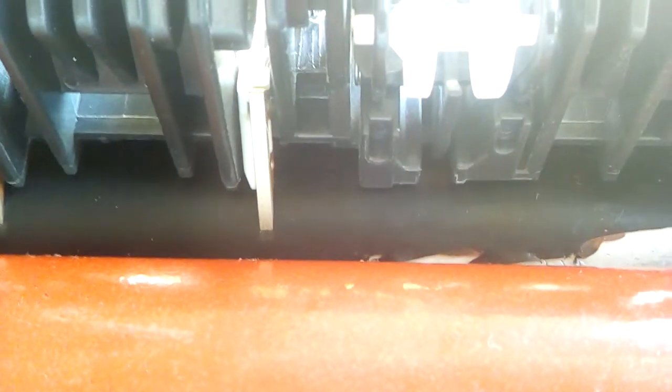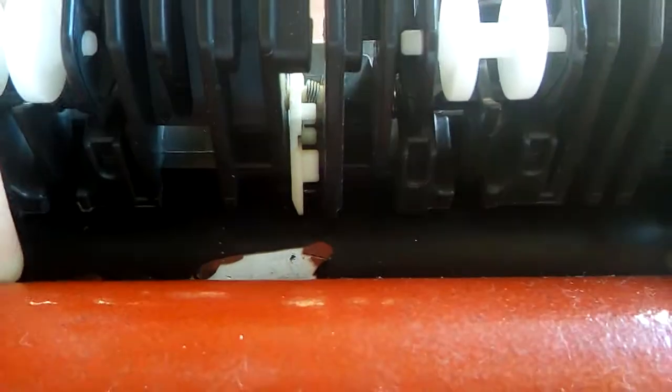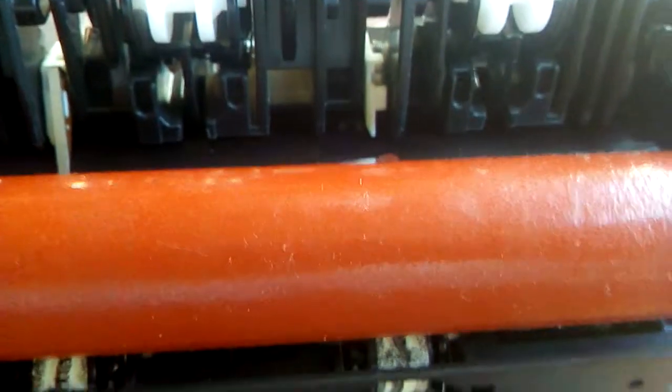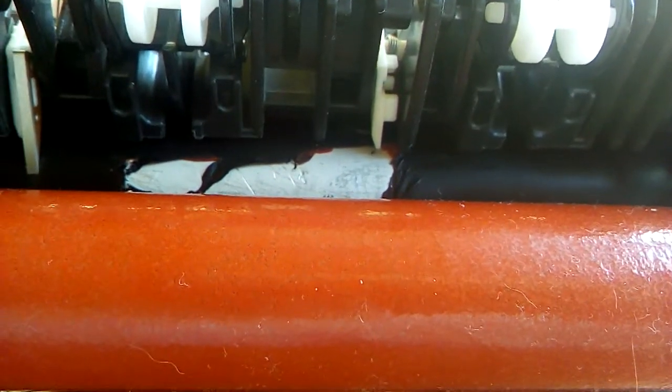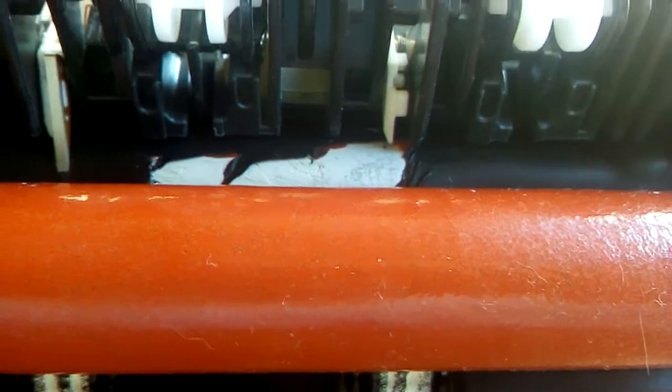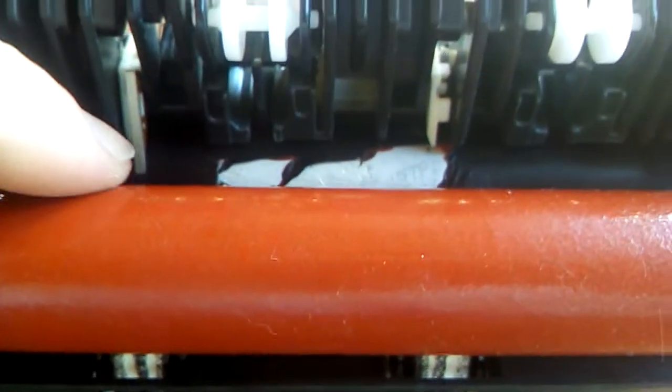They're a 2-piece unit. You've got one hard plastic Teflon coated gold coloured finger. It connects to the white plastic base, and over here we've got this one where it's torn it off. So what will typically happen is if you let it go too far and you let the finger dig in, it will tear the gold finger off.